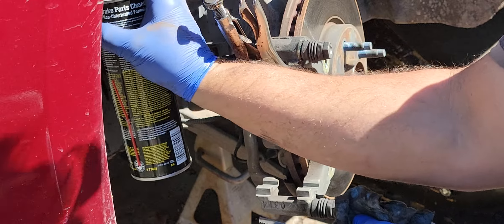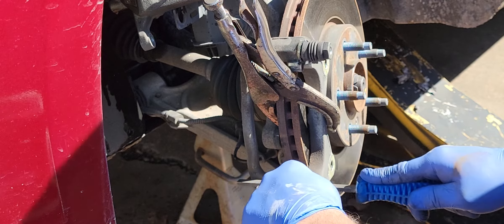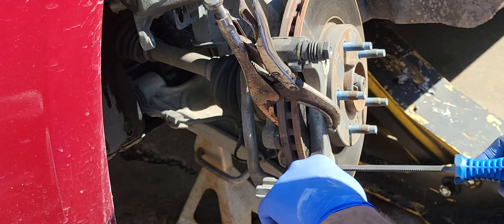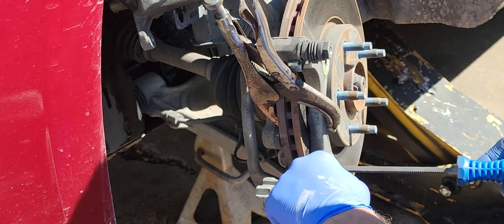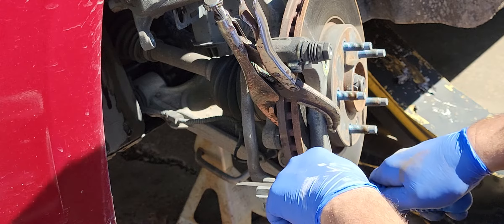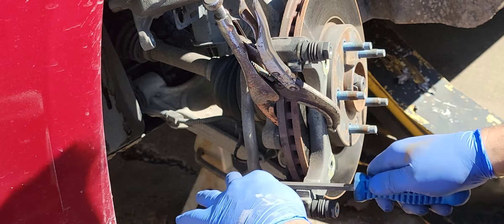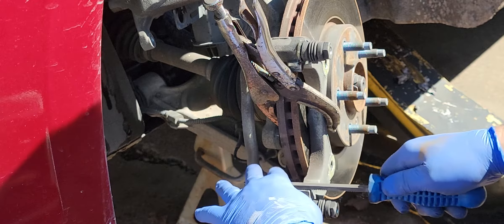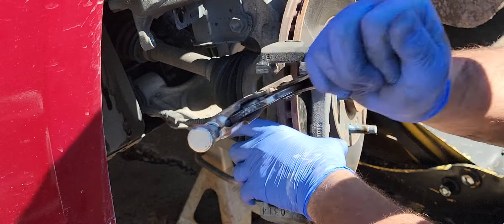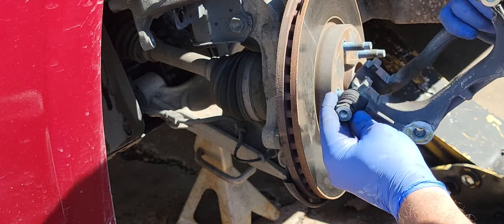If you're in a hurry, well there's all kinds of fast ways to do it. Just make sure you catch all of that brake fluid in a container and dispose of it properly because we don't want to destroy the whole world with brake fluid. This one is the top - the top of the pad area doesn't get the full weight of the vehicle when you hit the brakes on it. Looks pretty good. I've already checked my pins. I cleaned these rubbers up with some silicone - just sprayed it down and wiped them off. But the grease is nice.